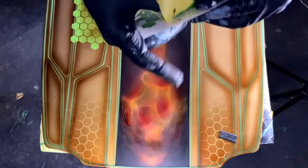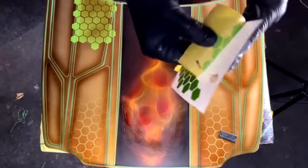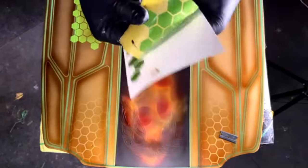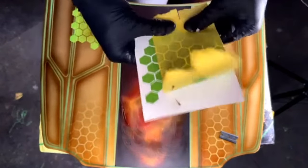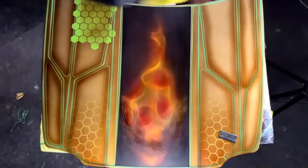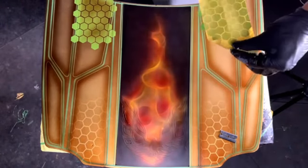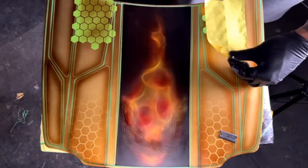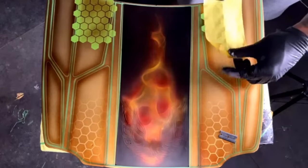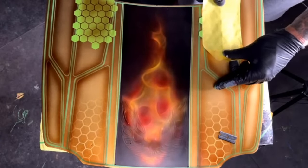Paint on there. How long do you wait before wet sanding and buffing a finish one spot panel clear? I like to wait 24 hours minimum, but no longer than like 3 days.